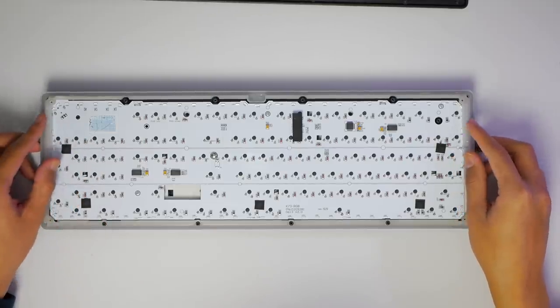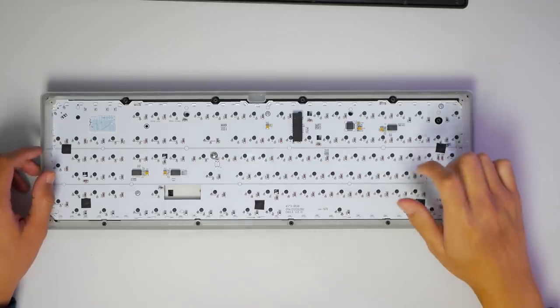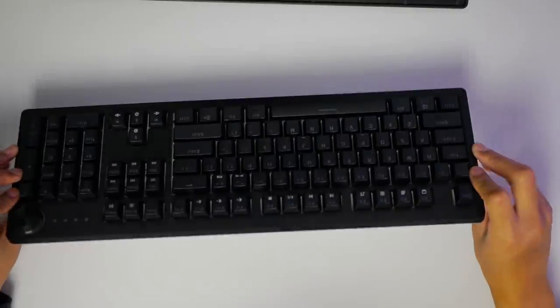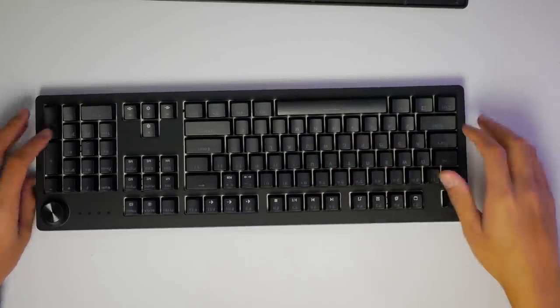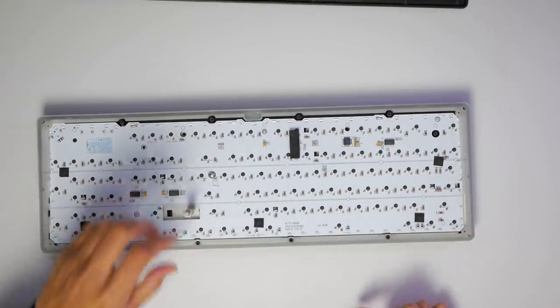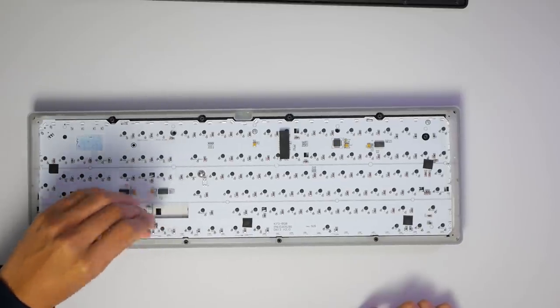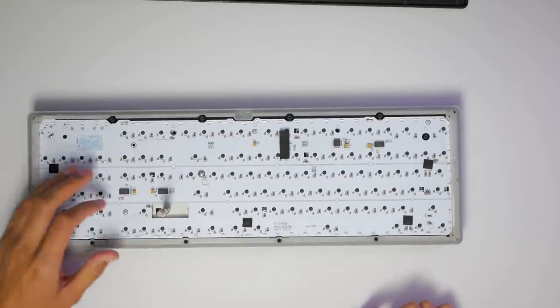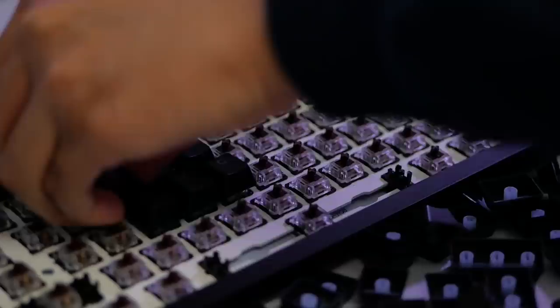We can also see that the RGB SMD LEDs for the key switches are completely on the other side and therefore protrude from the top, which is annoying for key switch compatibility, but that doesn't matter anyway with these Outemu sockets which are soldered in. The plate is made from steel and is probably the standard 1.5mm, so nothing too out of the ordinary from what I can see. So yeah, not sure what's going on with the ping. By the way, the keycaps do look pretty nice with the backlighting off, but it'll look even better with some new keycaps.